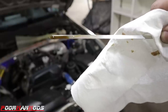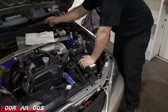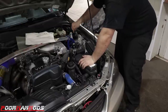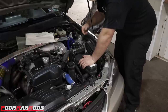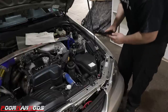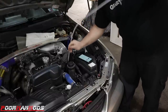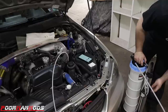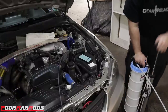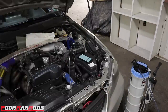This car burns a little bit of oil so it's not perfectly full — probably about four and a half quarts in there. It kind of feels like I'm going to be cheating because I have my oil filter relocated right up top, which will make this unbelievably fast — I don't need to get under the car for anything. But a lot of newer cars have it up top too, so it's pretty fair. Shove the tube all the way down until it hits the oil pan, pull up to extract. It's definitely slower than water because it's thicker.